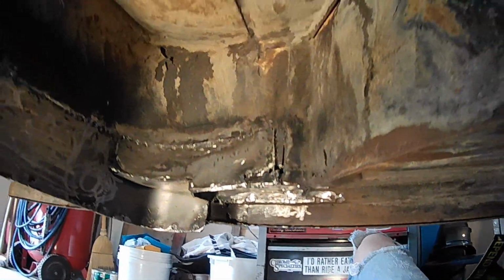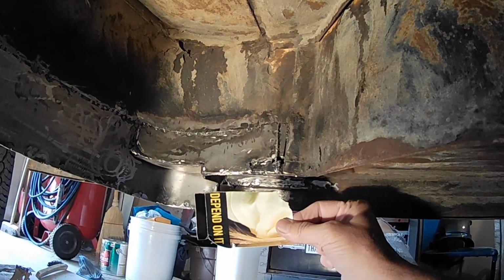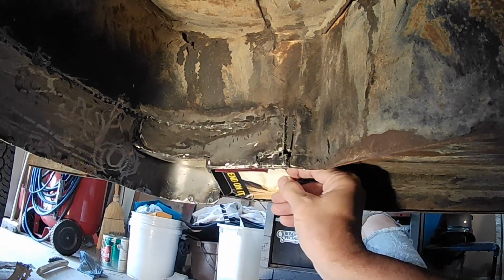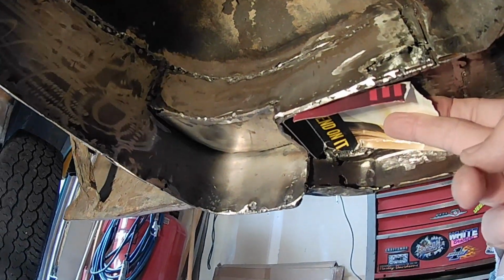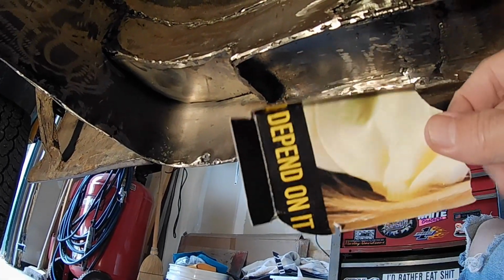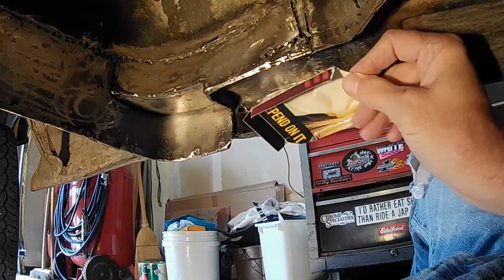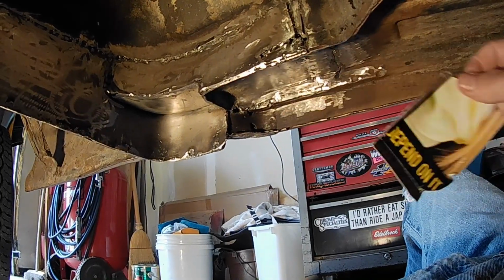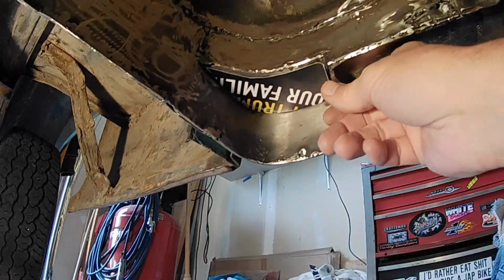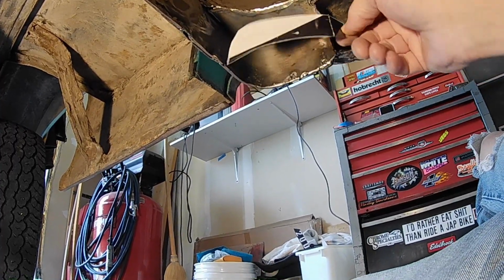Now, I wanted to show how I just use a piece of, I don't know, kind of hard paper. Sometimes even a cereal box paper can work. And you trace out the opening that you need. And then you cut that piece of metal out that's the same shape as this guy. You just trace it out, and then you've got your piece of metal. Then all you have to do is shape it. Same thing with this one here. Let's see, that's the original shape on this one. See there? And I just cut that out, and that ended up being one of my pieces.